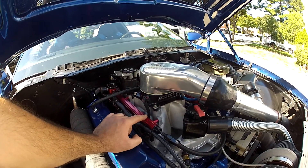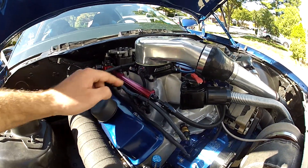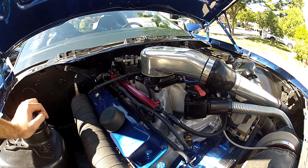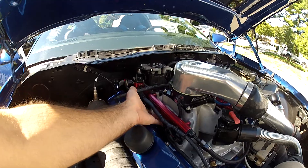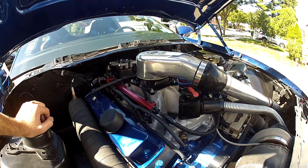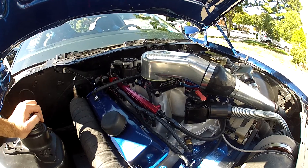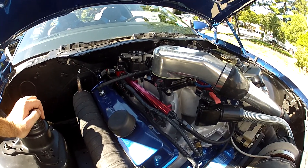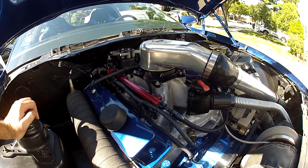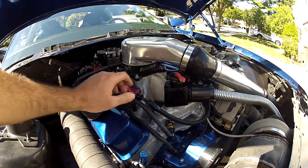You're going to need fuel rails. These rails are also from Pro Comp — they're made for this intake. The bosses fit pretty nice, no spacers on the injectors needed. Getting the rails to seal was problematic at first because there's a little plug that's a pain in the ass. Don't use Teflon tape or Teflon paste — none of that worked. What you use is PTFE Blue Monster tape. Put it on once and it's done — worked perfectly. Got the advice from one of my plumber friends and it actually worked great.